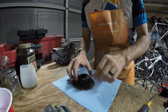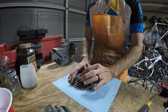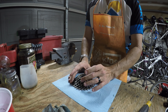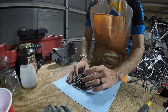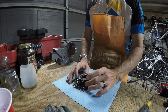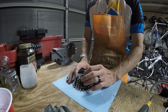Hello and welcome to another video for One Loose Sprocket. Today we're going to look at the Shimano 6-speed freewheel. The plan is to take it apart, confirm that the internal working mechanism is okay, repack the bearings, lubricate, clean, and overhaul it — then put it back together.